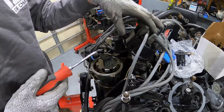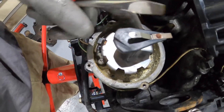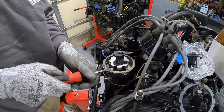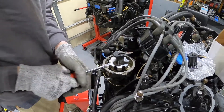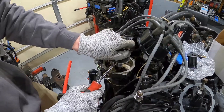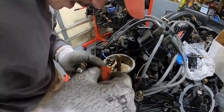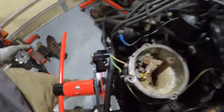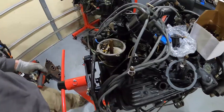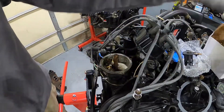I got the cap off and everything transferred over — that's set and ready to go back on once I get the internals cleaned up. It's a little gross inside there, which is expected with a marine application like this — it's probably never been opened. I'm trying to get this rotor off; it's giving me a hard time. Oh, there we go. Wow — corrosion, lots of corrosion. I might take the vacuum to this to clean up some of the corrosion. The distributor housing itself looks fine to reuse — all the electrical components come from the cap, so I'll throw that old one away.